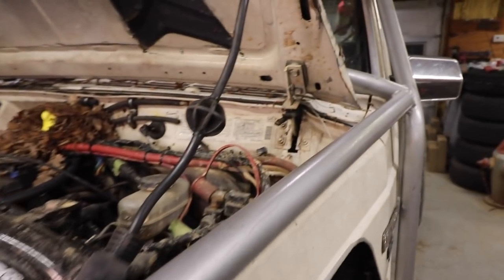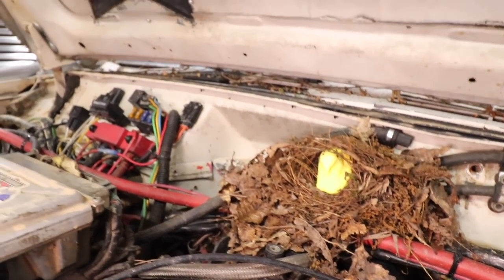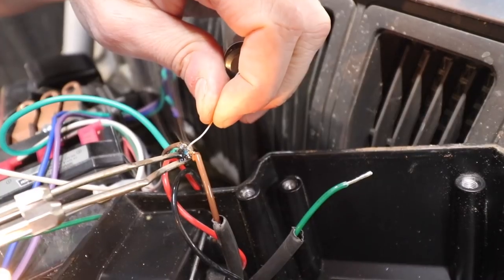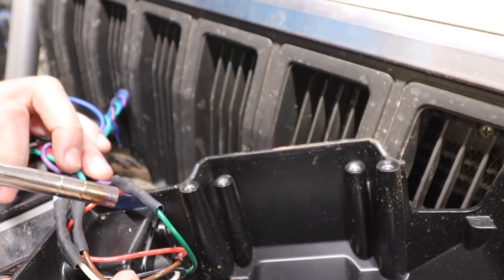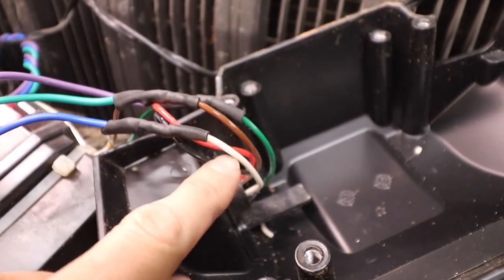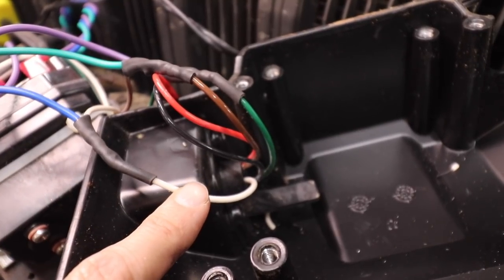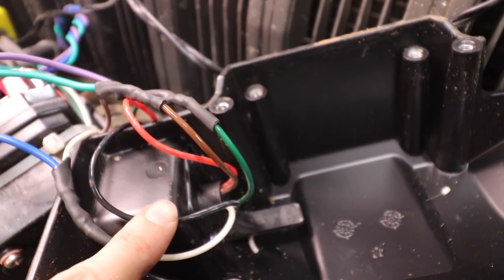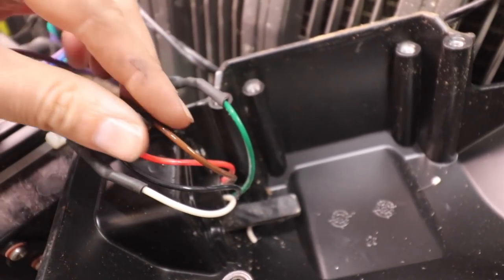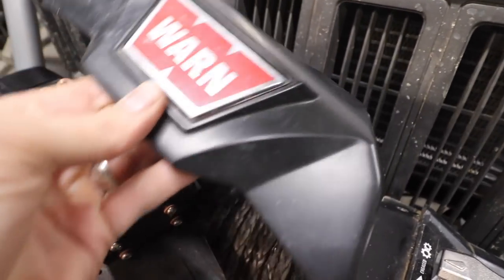There were four wires from the cab, but one of them is diverted to hot over there. Here's the wire summary: white wire is in or out signal; black wire is ground to chassis; red wire is positive to battery; green wire is in or out — opposite of white; and brown wire is switched ground to the relay. We zip-tied some of this up and we're going to put it back on and tidy it all up.